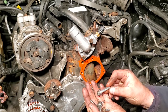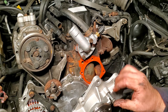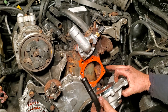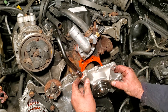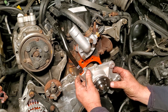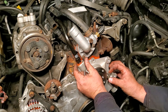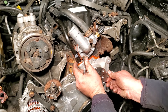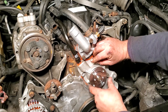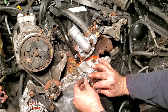We've got four cleanly brushed water pump bolts. Let's start with the long one — the long one goes right here on this outer big meaty part. We'll line everything up, make sure it's in the right orientation, and here we go. The next one is the smaller one — the big one and the smaller one are adjacent to each other. And we've got the two medium-sized ones, both going on the bottom.